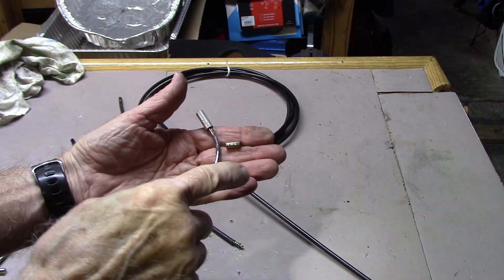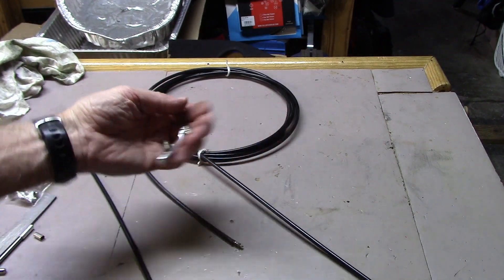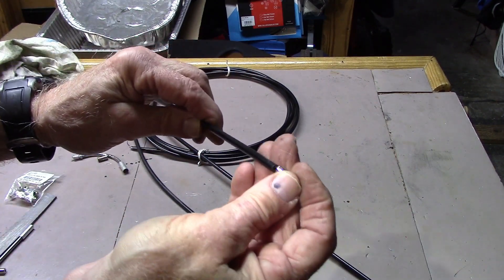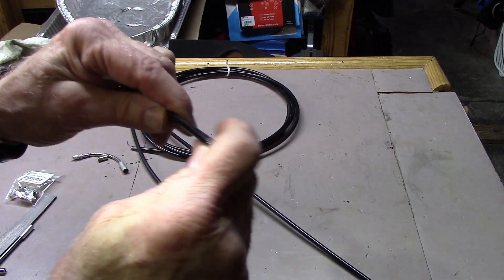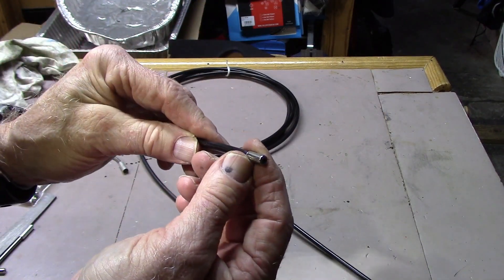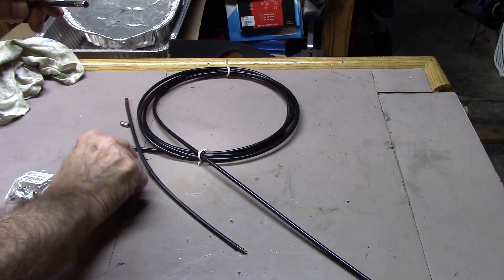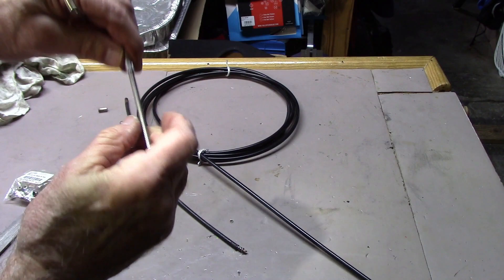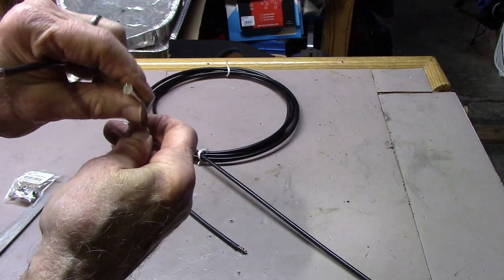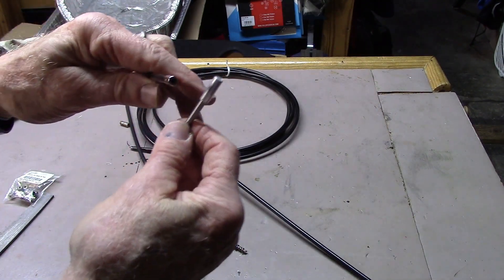Because of the poor condition of the old ferrules and the noodle, we're going to replace those. We'll take our new section of cable and use a 5 millimeter ferrule at one end — slides on. Some people will crimp this with their wire cutter crimper so it doesn't fall off. We'll replace the old noodle with what we call a flexible noodle, which is pre-greased and Teflon coated. We'll go ahead now and replace the brake wire.